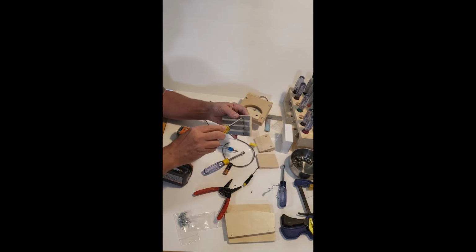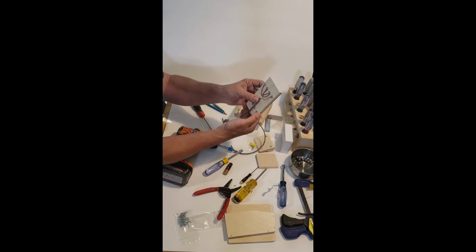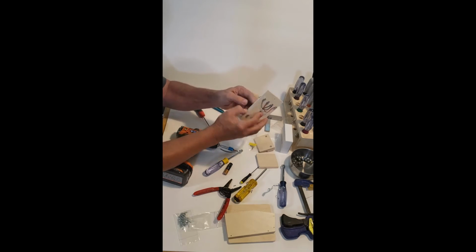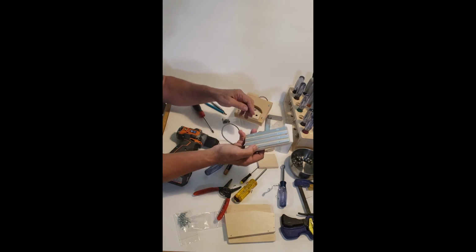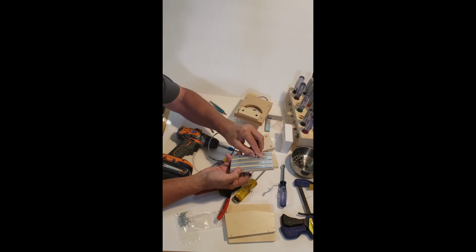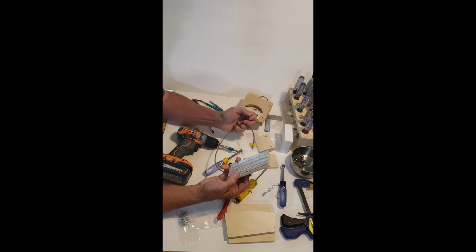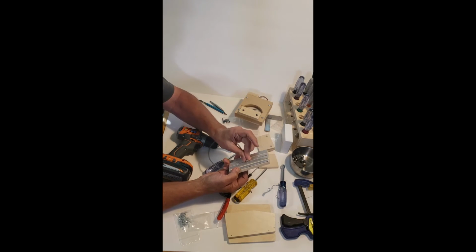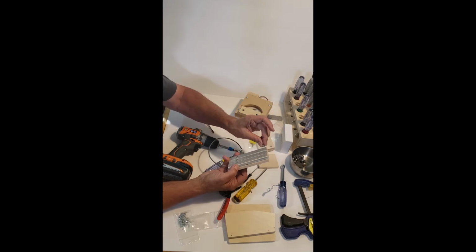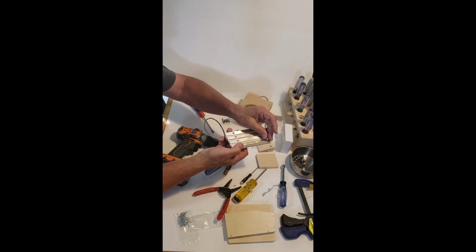There. This is what you're left with. What's happening here is that adjacent rails now will complete the circuit when a ball touches. So this is a switch. These two wires on this end will complete when anything happens like this, whenever a ball's anywhere here. That's why we got these things sloping to get the ball over into the center.